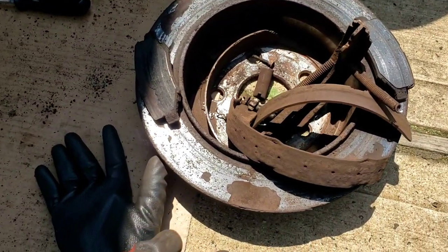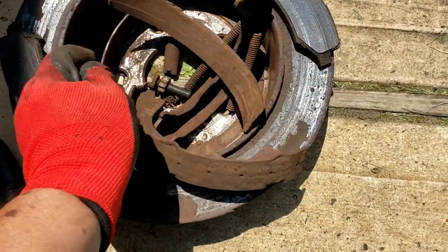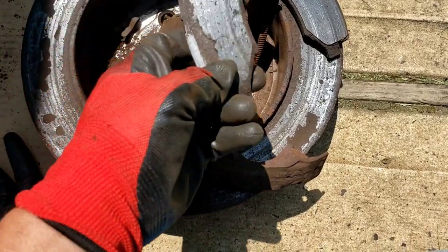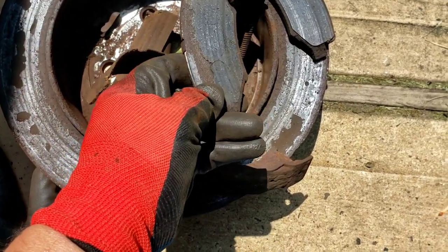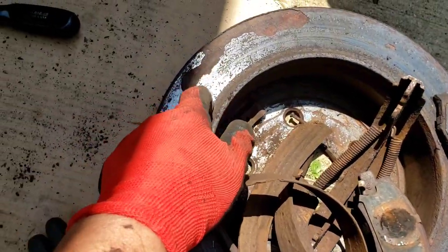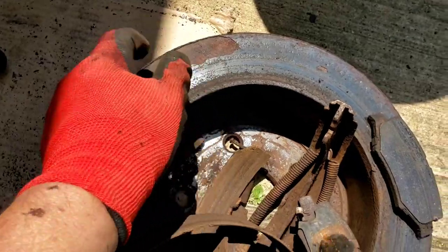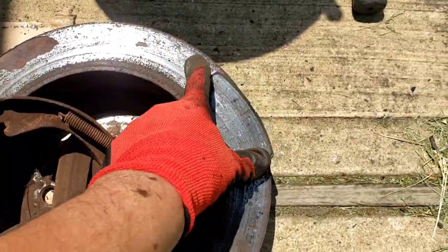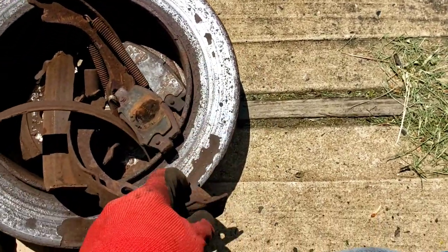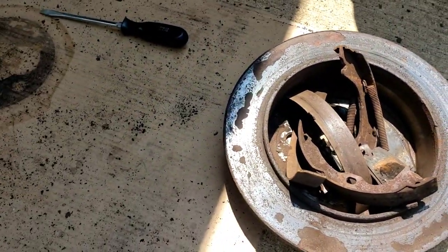You want to see what that right rear looks like? Look at the shoes on this one - the material fell off the shoes. Brake pads are down to metal. You ever see a rotor peel? Look at that - the glazed part and there's the rusted part. I've never seen that before. Cracked shoes of course. Change rotors and brakes people - change them as a pair. Ciao.